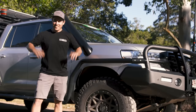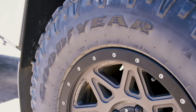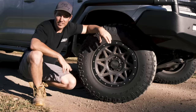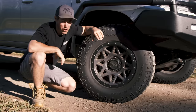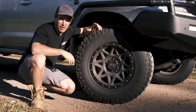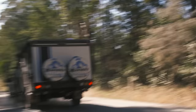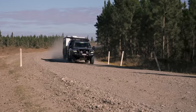Another thing that's often overlooked but essential for towing big loads is your wheels and tyres. We commonly choose wheels based on looks and tyres based on off-road performance, but if you're carrying weight you also need to factor in the load rating of your wheels and tyres. When it comes to choosing wheels, don't just choose something aesthetically pleasing — choose something with a high load rating. Typically with a big GVM on a vehicle like this you're looking for a load rating of around 1,500 kilos per wheel. I went for Goodyear Wrangler Duratrax because they have a maximum load rating of 1,750 kilos — times four that's 7,000 kilos, which allows for a full load, a heavy trailer in tow, and some room for when extra load is applied hitting a washout.